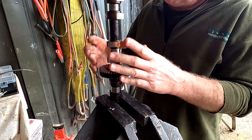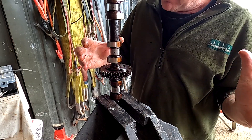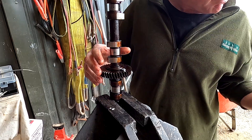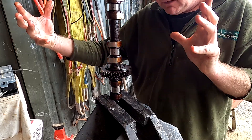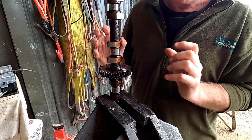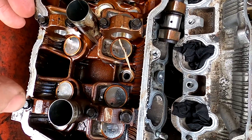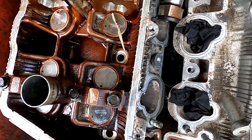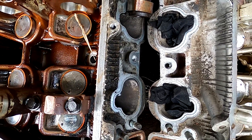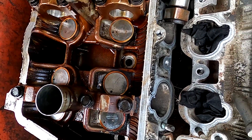I had to take these out because the engine it came out of had that bent rod, so I couldn't rotate the engine. I just pulled these out — they went ping and popped apart — and then I reset it on the bench. Very quickly while we've got this out, you'll see this one's quite clean and that one's quite dirty. That's due to the PCV valve system — fresh air is entering on this side and it's leaving on this side.